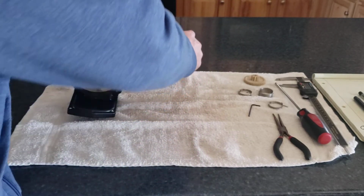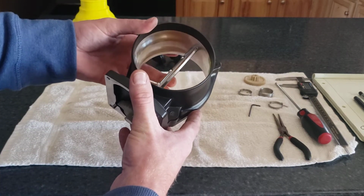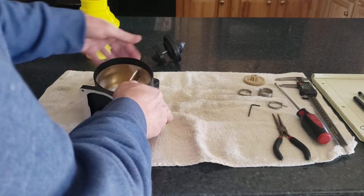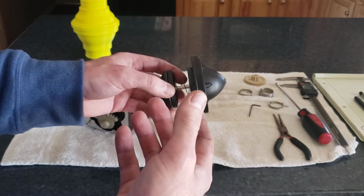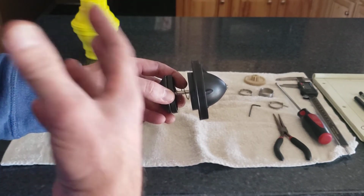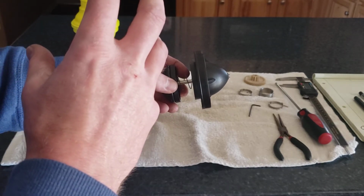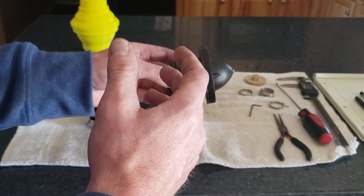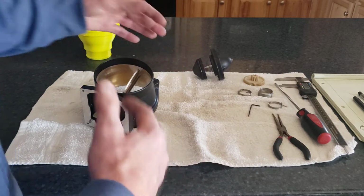So, the alternative that I'm going to attempt is to use an electronic throttle body. So I've already modified this one, and there's one definite benefit to using something electronic, is that because this valve stays naturally closed, it forces all of the air during idle and low load conditions to go both through the turbocharger compressor and through the eBoosters. And so both of those things sitting at the back of the car, there's a long charge or intake route, plus the turbo compressor and the eBooster compressors all provide some degree of restriction that isn't optimal for light load when those guys aren't working hard.